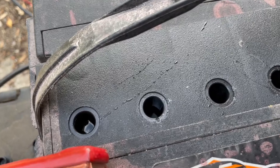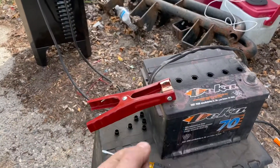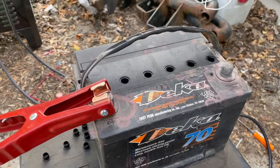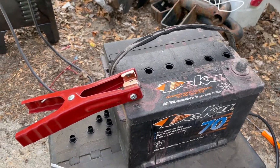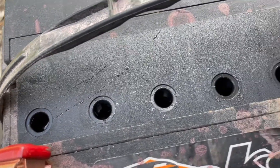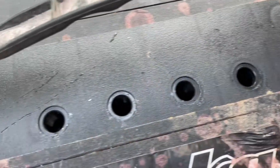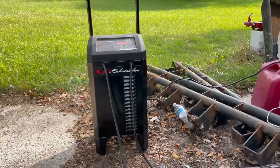The water will evaporate in there, so I've filled the cells with distilled water just to about the top. Then what you're gonna do is cycle it five times: put it on 200 amps, hook up the negative cable, let it go for 15 minutes, unplug it, wait an hour, and repeat that process five times. If you look inside the cells while doing this you'll actually see the water start to bubble and boil — it's cleaning off the plates in your battery. We're gonna have a brand new battery for about two bucks.